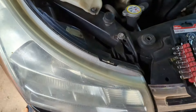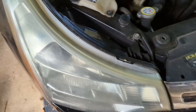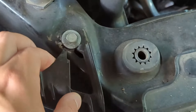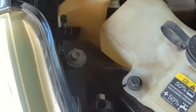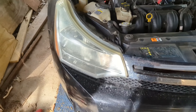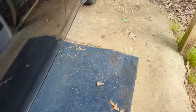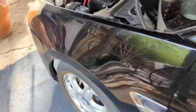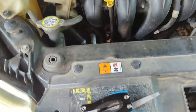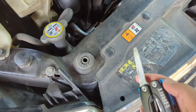Starting the procedure, I'll take off the headlights first. Normally you'd undo all the bolts here, there, and there — but you might notice these headlights are so old and brittle that the bolts aren't actually holding the lights onto the car anymore. Some clips under the grill are holding everything in. To get these out, we do need a flathead screwdriver. I'll use the flathead on my multi-tool and show you quickly how to take these plastic clips off without damaging them.